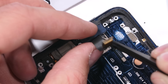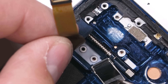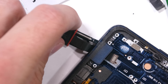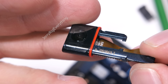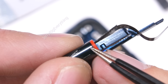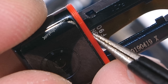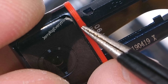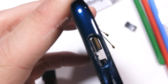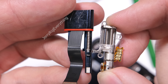The camera itself has one last silver bracket holding it in place with two screws. This bracket keeps the camera from being pulled up and out of the top of the phone from the outside. And this is it — a 16 megapixel motorized pop-up camera which, just like the charging port, has a rubber seal around the base, and it's red. So whether the camera is opened or closed, the red rubber seal should be in contact with the side walls, effectively keeping water from getting inside the phone. It's splash proof — pretty ingenious design. I'm a fan of these motorized pop-up cameras. I don't think motorized components are the long-term future-proof solution for bezel-less no-notch displays, but I'm sure going to enjoy them while they're here.